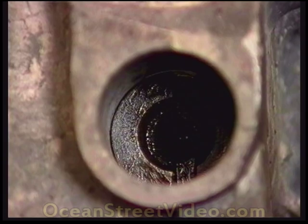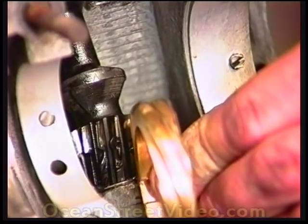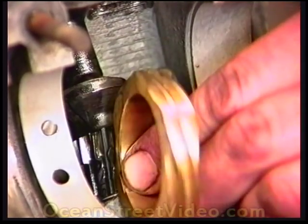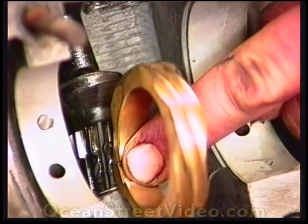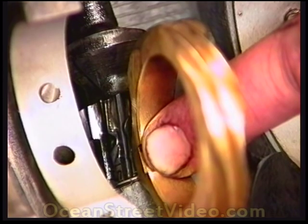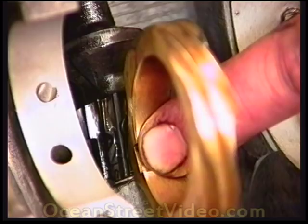The marks in the timing gear should end up being vertical and on the right side of the center line. Here's how this gear — this is the brass gear that we mounted on the crankshaft earlier — rides on the distributor timing gear. It meshes just like this. So when the crankshaft rotates, so does the distributor drive gear.